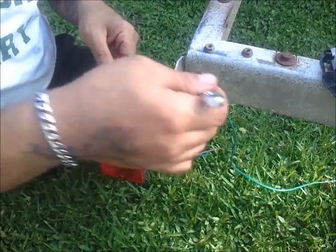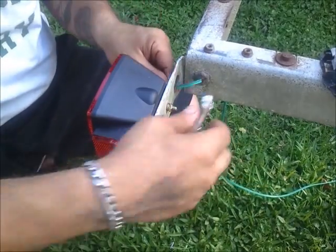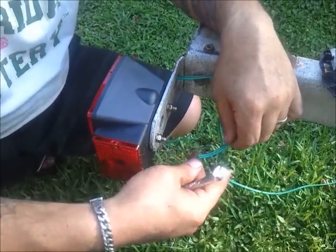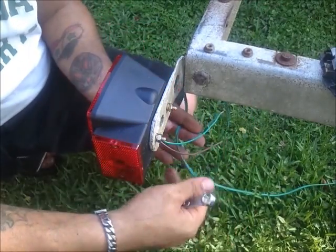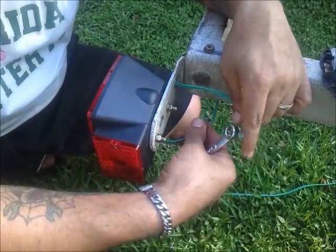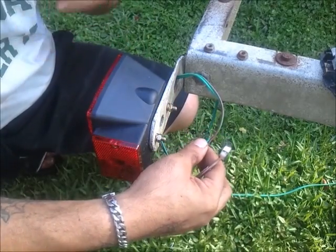What I like to do with the wire, I'm not sure if you can see clearly, there's a hole right here. Since it's coming out of the front side of the trailer, I wrap it back around and make my light connection back here. With a connection back here, I'll pull my extra back through, or we can run it up underneath, so that I don't have anything hanging. I'm not one that likes hanging wires. I don't mind a little bit back here, but this is better than having it droop up underneath, for my sake. Yours might be different.